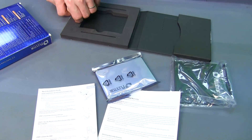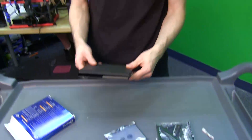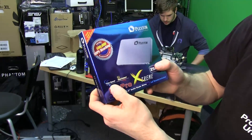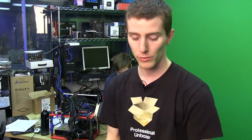And of course the drive itself. A lot of people might not know this, but Plextor is actually a major SSD manufacturer. They make their own SSDs using Marvell controllers with custom firmwares that include their TruSpeed and TruProtect technologies. TruSpeed is basically their way of saying that regardless of drive use and trim, the drive is constantly performing maintenance on itself to keep it at or near its brand new performance.